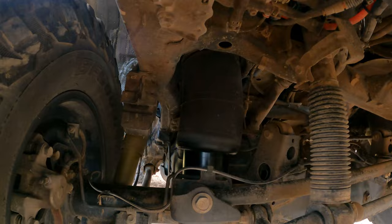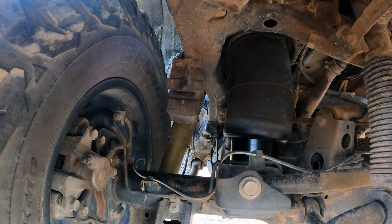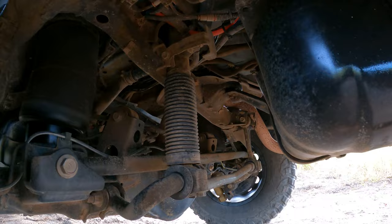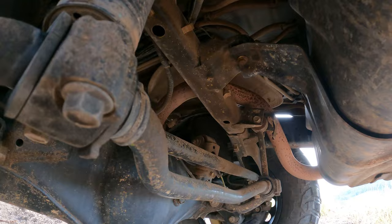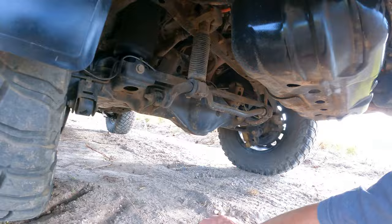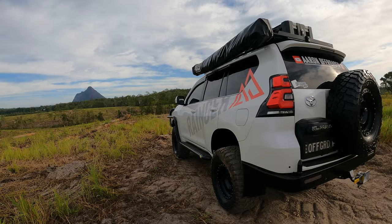Now that we can see under here, you can see the airbag setup — three settings: high, ride height, and low. Two Dobinsons shocks. And then this is the KDSS sway bar setup — here is your hydraulic cylinder attachment to the diff housing, and then the other side is actually fixed — that side doesn't move, it's the mediator for the tube, and then this one does all the adjusting. On-road it'll stiffen up in tight corners, and off-road it'll let it go loose so it can articulate — a pretty good system. The size of those control arms is crazy.